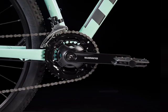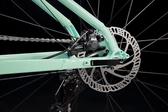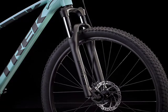3 speeds on the front isn't great for climbing efficiency, but with 7 in the rear, it comes close enough. The tires are going to be the Bontrager XR2 Comp wire bead tires. Bontrager is Trek's in-house brand, and these are the tires you're going to see on all the bikes in this video, excepting the last one, the Trek Marlin 8. For the brakes, Trek has provided the Tektro MDM281 mechanical disc brakes, with 160mm front and rear. 160mm is kind of small, but seeing as this is an XC-oriented bike, you're not going to need such big rotors. The fork is an SR Suntour XCE28 coil spring fork with a preload, meaning you can harden the fork for the uphill so you don't get sag as you pedal.